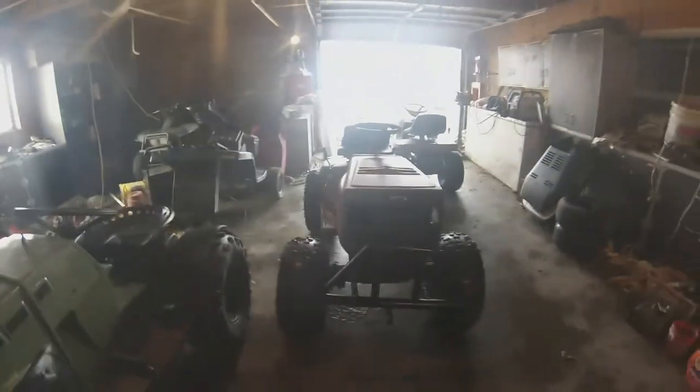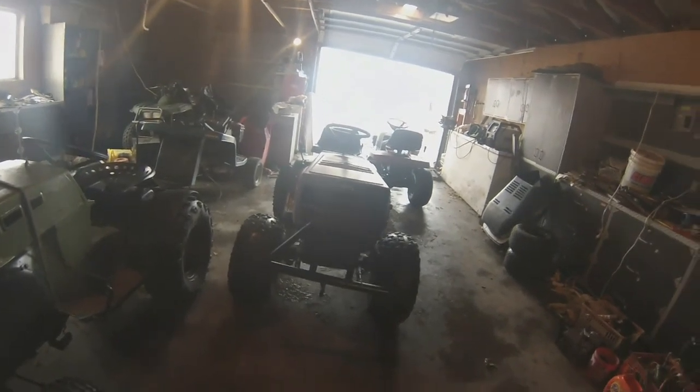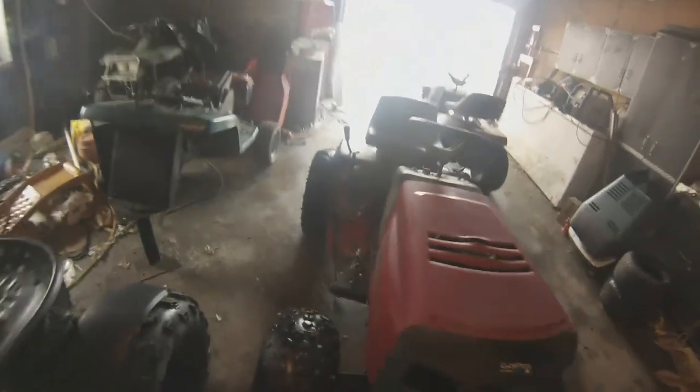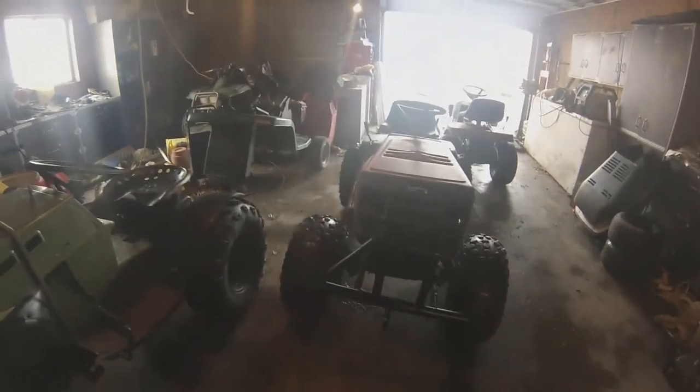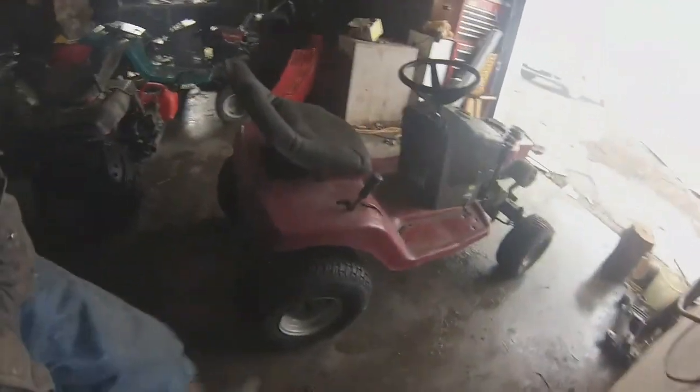I also painted the bumper on this thing. As you saw in my last video, my wheels were pretty far spread apart because I bent the tie rods. I had to cut like two centimeters of the tie rod out on this side right here and weld it back together to pull the wheel in enough — it was pretty badly bent. I like the look of the new tires, and these tires are also an inch bigger than the rims that were on there, but I just had these sitting around so I used the rims out of them.